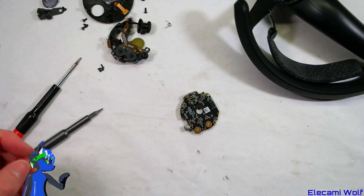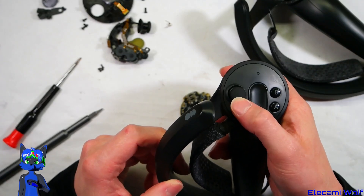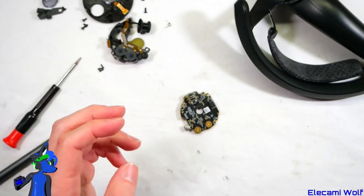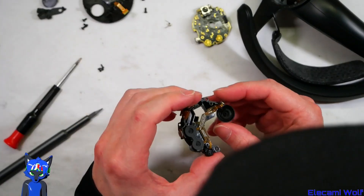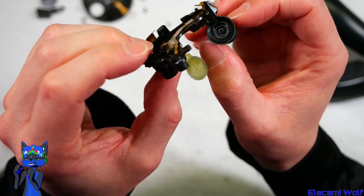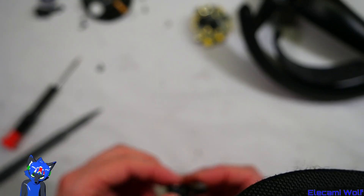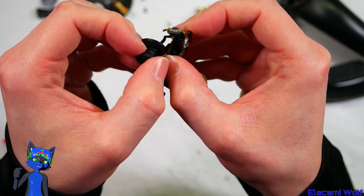I replaced the one in my other controller a couple of days ago because it wouldn't return to zero on the up-and-down movement. Put in the new stick, put it all back together, and everything's good. This other controller didn't have a problem with the stick touch, but in this case the problem is the touch sensor on the joystick. Presumably it's that ribbon cable that has been pinched — it does seem sharply bent there. I'll have to investigate and work out what can be done.